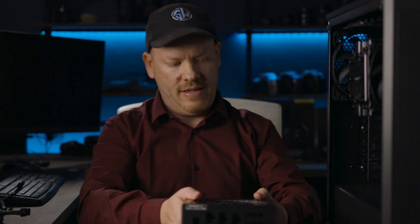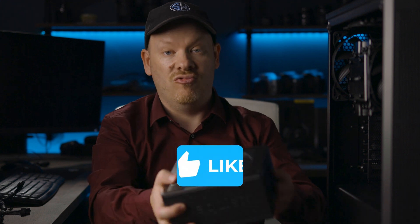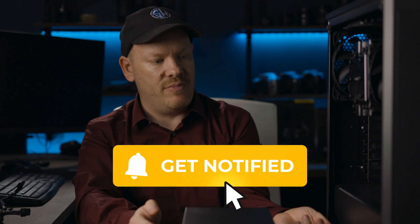We're going to get the power supply. The orientation of the power supply all depends on where you're putting it. If you're going to put it on the carpet, then you have the fan up blowing down. This system is going to be on the desk, so we can put it the right orientation, which is fan down. That will suck air from underneath the computer and in. This case has mesh on all of the fan intakes, which is a nice thing to keep it maintained.